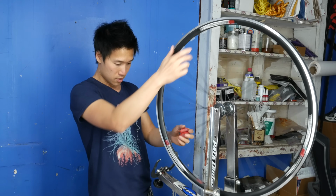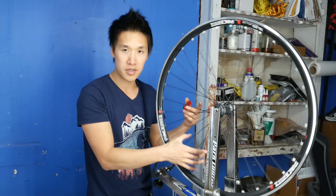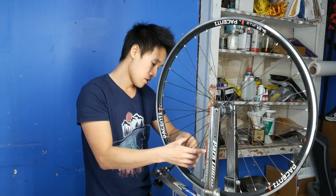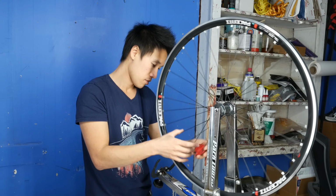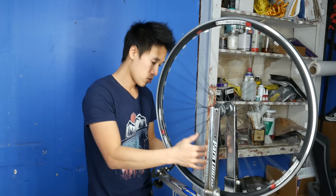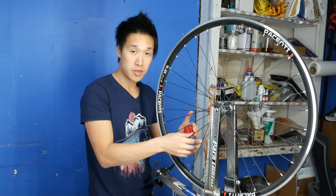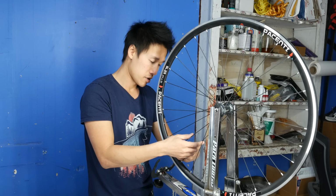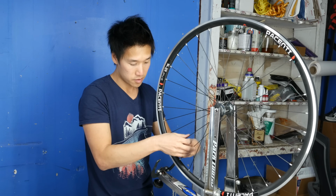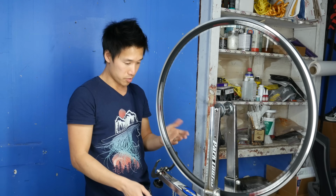Okay. Now that high spot is like a couple microns thick at this point. I can just do a 1/8 turn. Okay, so I got one more high spot, and it sits directly between 2 spokes again. I'm just going to tighten one spoke, the spoke closest to the high spot, by 1/8 of a turn. And the wheel looks really good at this point.